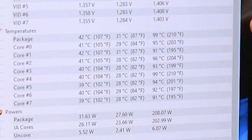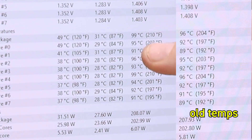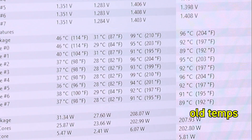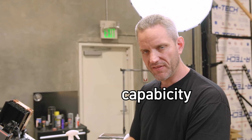We clearly gained some temperature across the board — we gained 3°C on the package, going from 96 to 99°C. All cores seem to be up between 3 and 4°C, with one core almost hitting 100°C. Remember, 105°C is where this CPU will start to throttle. This is a completely unrealistic test, but if an A/B comparison is what we're looking for, we can discern that when we're testing the max cooling capability of the cooler, the paint did insulate and cause less efficient heat transfer.